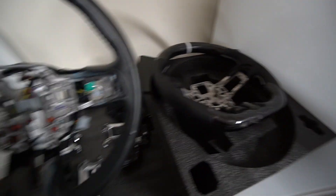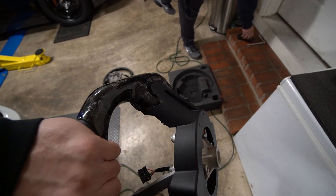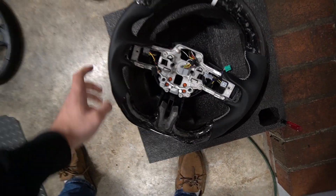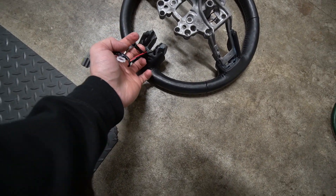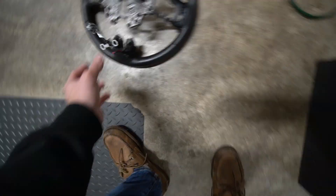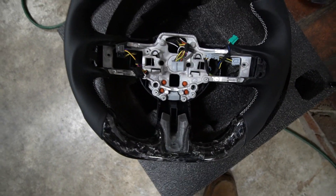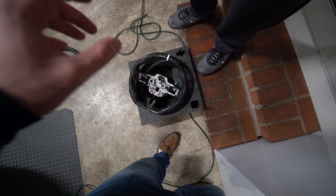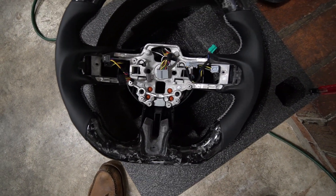Just got done swapping the wires over and the plastic cover — just got to prop everything back in. I was just trying to tuck in some of the wires, because if you have a heated steering wheel and you did not get the heated option for your new one, these two wires will be left behind since they are connected in the steering wheel. The little wire connected to this you can run right along the side, down the bottom, and kind of bury it and tuck it in so it doesn't get in the way. Next step is assembling all the stuff back on — we're gonna go step by step, one side at a time.